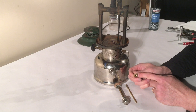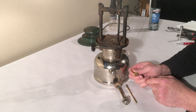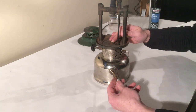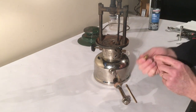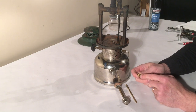The very first stove I ever bought did this, and then I sent it to someone to remove the check valve and fix it because I didn't have the proper tools at the time. He supposedly replaced it but when I got it back and went to use it the next summer I had the opposite problem. I pulled out the pump handle and went to push it back in and it wouldn't budge. That was because the ball was sealed in the closed position and it wouldn't let any air past.